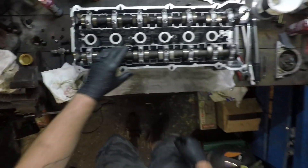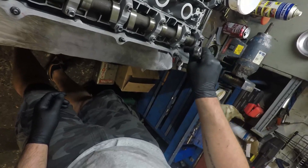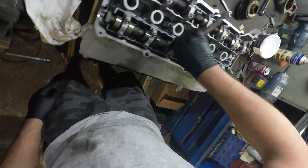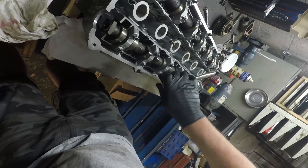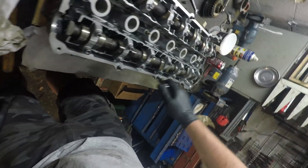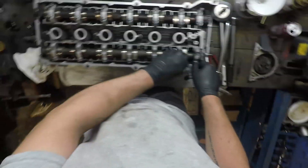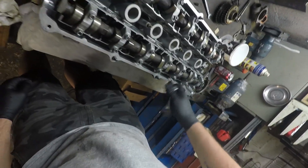So all the nuts are now screwed on. I can start working on the two tightest caps — cap three and cap five — giving them a quarter or half turn at a time, then repeating the process. I'm using those to draw the camshaft down, then finger-tightening the rest of the nuts since they're essentially just loose. I keep working the two key caps down nice and slow, being careful not to put too much pressure on one before the other, or the cam will go down at an angle. I'm also tightening up the rest just to take up the slack, working them all down gently using my fingers rather than the socket and ratchet.